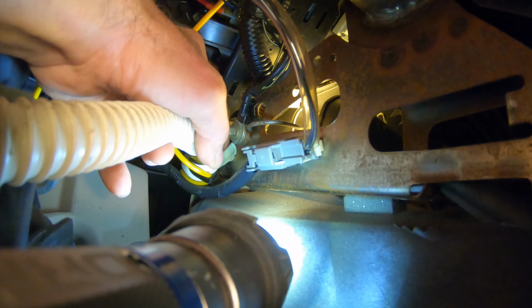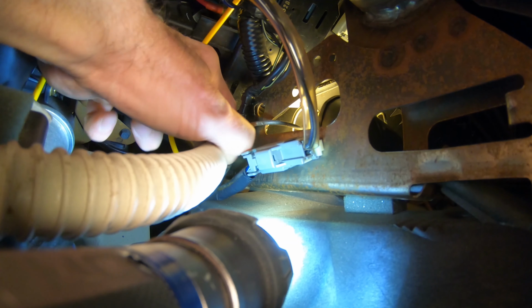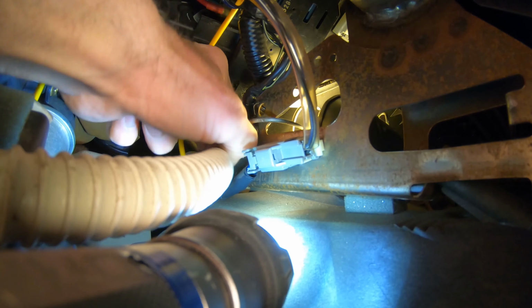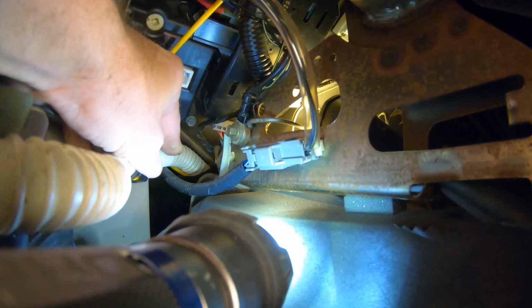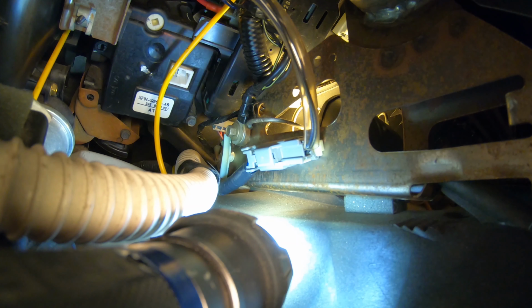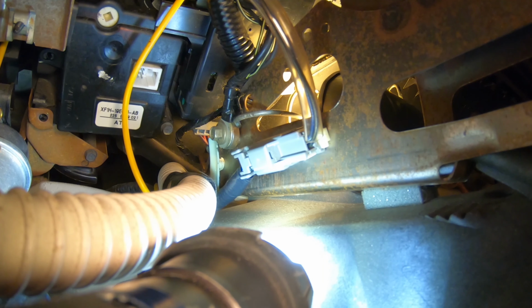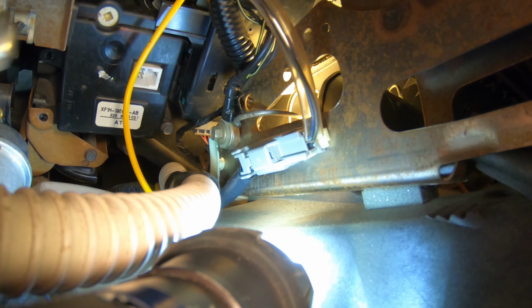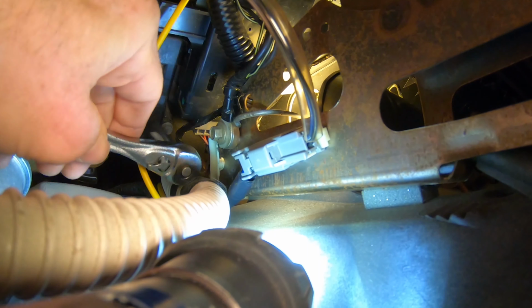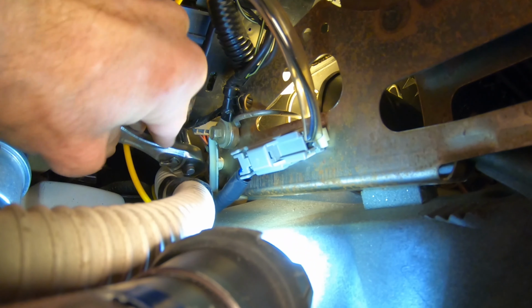That's two down. Nevertheless, before we proceed, we got to get this duct out that goes to that sensor that we unhooked earlier from down below the radio for the temperature. I actually wanted to pull the clip out, but tape came loose and the clip stayed in place, but they can just be retaped up. And now we're going to take and get to another one of these screws that hold this actuator in. That one right there, see, we're up to number 3 now, and there's still 2 more to go.